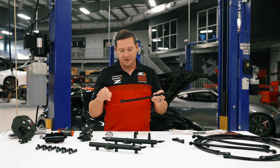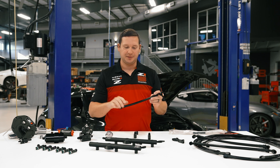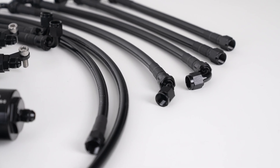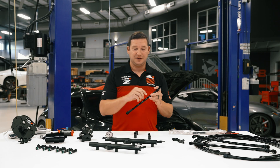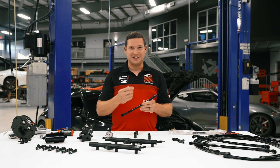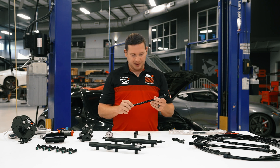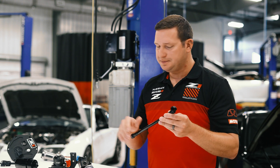From an installer perspective, the PTFE is going to be compatible with different fuels and it's going to last a long time. It's very robust being stainless steel reinforced, and the PVC coating makes it nice on an installer. If you've ever been bit by a frayed piece of stainless steel line, it's not pleasant — it's just like a needle that gets you, usually you don't see it coming. It's sleek as well, even under hood it looks kind of discreet.